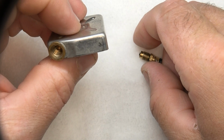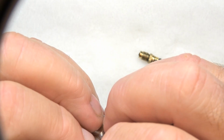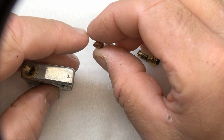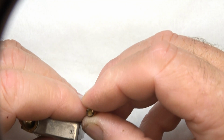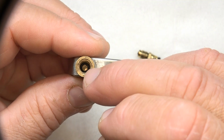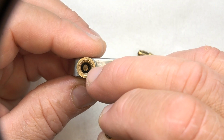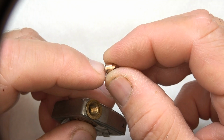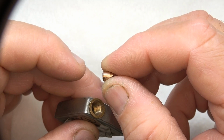That's about a 5 o'clock position, somewhere around there. There it is. I'm going to tell you something, folks. That didn't come out like that before. All right. Keep in mind, that didn't come out like that at all. Matter of fact, right down in there, you should be able to see it, there's a little bit of a wick that's hooked on some brass, okay? Don't even mess with that wick. The only thing down around that is a seal, an O-ring. Okay? And I think it's about a 5 millimeter OD, and probably about a 0.8 thickness O-ring. All right, let's see what I'm talking about here.